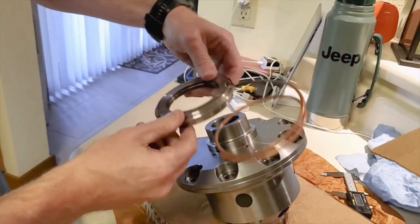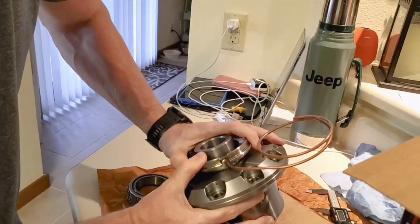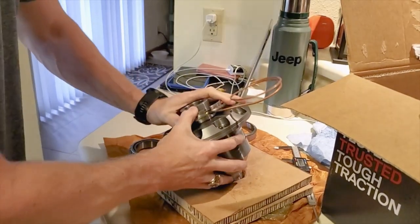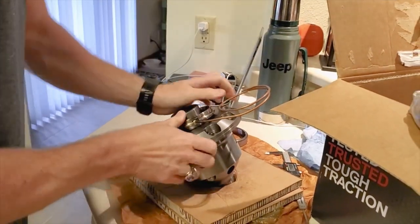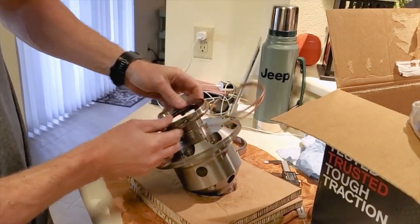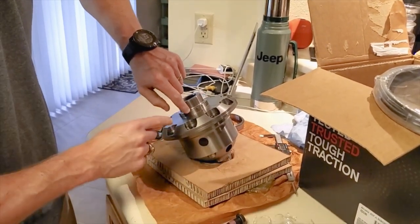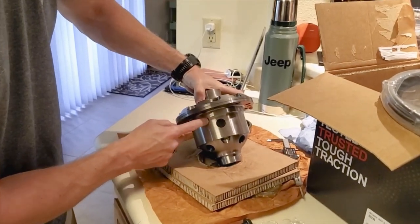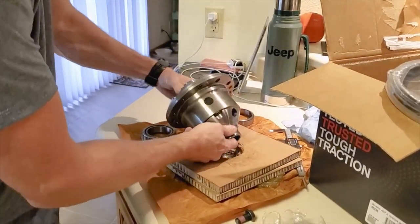If you look, there's the little hole and there's a little hole — when you press-fit this on and grease it, it'll sit down on there. The seals need to be greased so they'll go on, but these holes will line up. At any given point the air will travel around this circle and then push air — it calls for 85 PSI, but I think the pump does 100. It'll push air into here and you'll hear a click inside the locker. I went outside and tested it — I did hear a nice click, and then it locks both shafts up inside here.